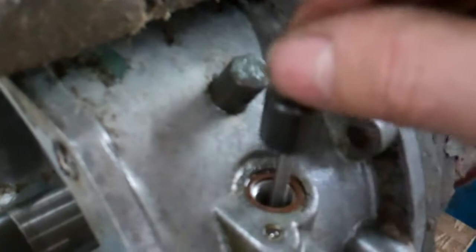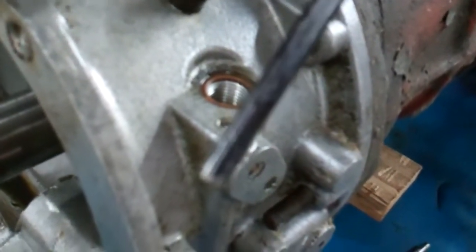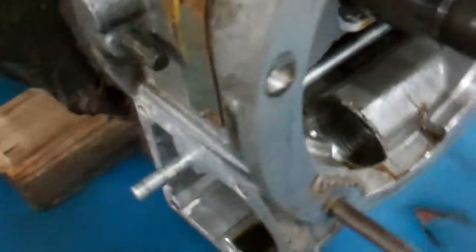That ain't gonna happen with oil only to the high mark on this stick. So what I ended up doing was taking out the control valve and making my own little dipstick with a black sharpie on there for contrast. With the sealing washer in place, drop this down here and you can see it comes almost right level with this casting right there. And that means your level is going to be here — it's going to come out and fill the tail housing.